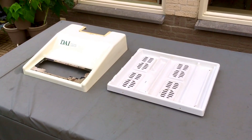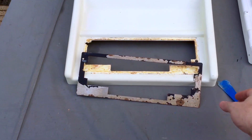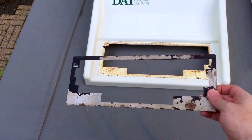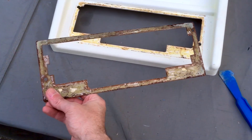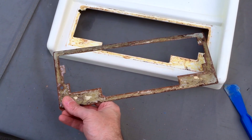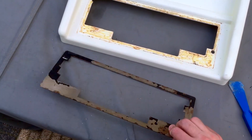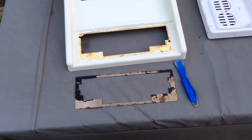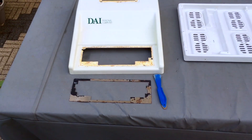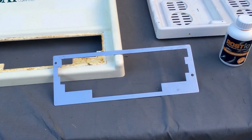The bezel was priority because it was so rusted, so I had to pull it out very delicately with a plastic spatula. It's also corroded on the back, you see — water or liquid got in there between the case and the metal bezel and corroded everything. So no paint will survive this. I have to sand all that corrosion down with a power tool, which is of course what I did.